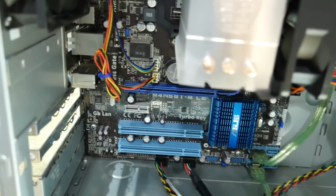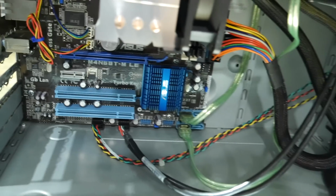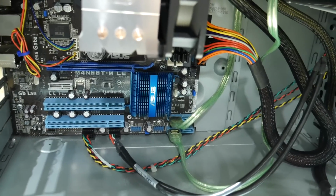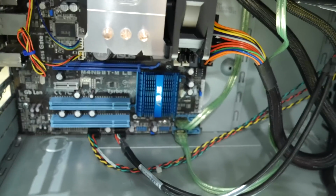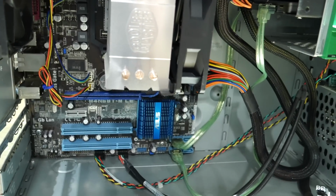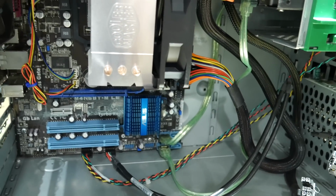And a lot of times the front panel audio connectors were the same way. I'm really glad I don't see cases like that too much these days, because that was incredibly frustrating, and there was a lot of times where people would get the pinout wrong and burn up their USB devices and or the port on the motherboard.